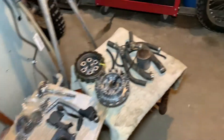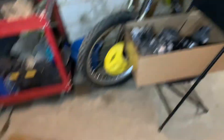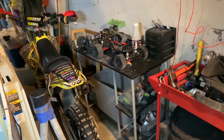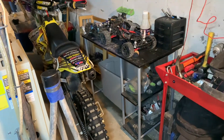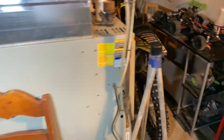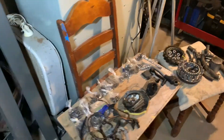Something came in the mail today — I think it's parts for the YZ250. That bike's gonna be running sooner than this one. This bike is gonna be running pretty soon too, all it needs is rings. The piston is brand new but the rings weren't broken in properly, so I gotta check the cylinder, rings, piston, and crank to make sure everything will still work if I just replace the piston rings.